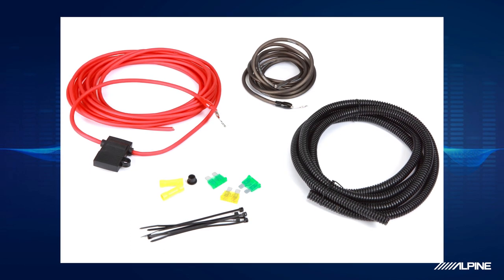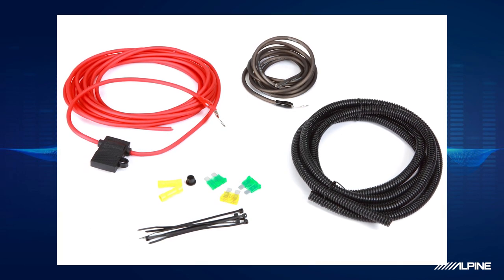Now, when installing the KTA-200M, we're going to need to run a power wire all the way to the battery. And the reason why is because this thing pulls a lot of power. Now, your radio harness is probably not going to have enough to support that, so we're going to run an amp kit, something similar to what you're seeing on the screen right now. You don't need too much for this, just about a 10 gauge amp kit will work. As long as it can do 20 amps or higher, you're good.